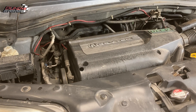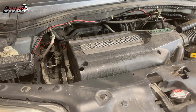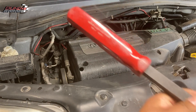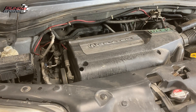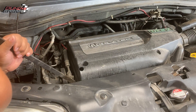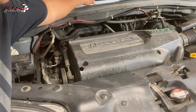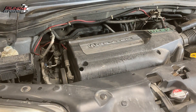What I need to determine is if it's the front or the back. The way I do that is I get a long breaker bar — this one is from Sears Craftsman. You take it and place it to the rear valve cover and see if you hear a noise. It sounds to me like it's coming from the rear cam. The valves in the rear are not adjusted correctly, but let me pop this cover off to confirm.